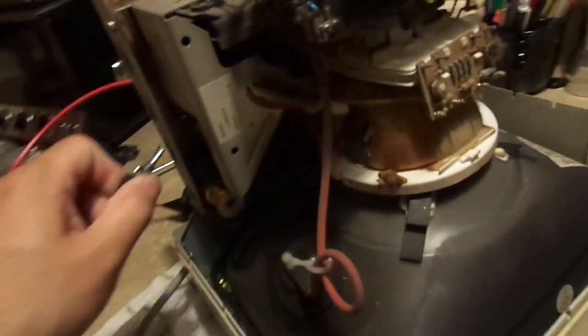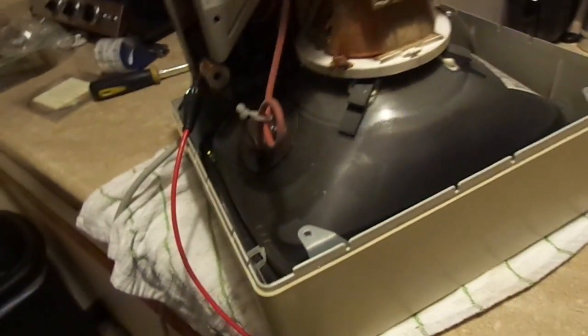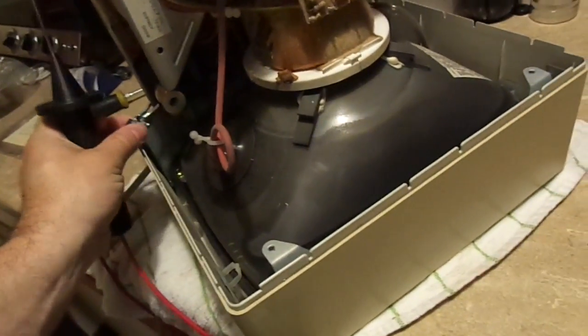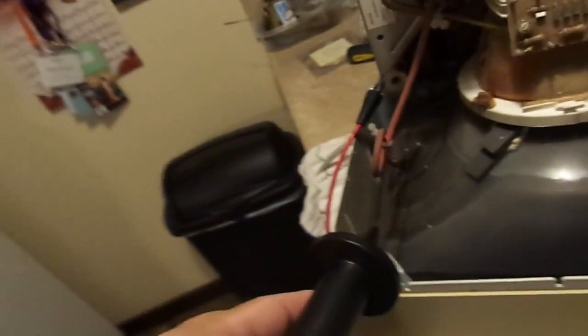What we're going to do is clip this to the chassis ground like so. A couple of things you need to know: most modern CRTs are designed to bleed off excess voltage when shut off, but sometimes those circuits can fail. They don't always work like they're supposed to as they age. So it's better to be safe than sorry. We need to stick this little probe under there — you may hear a bzz or a pop — and the point is to get it touching the metal clips inside.